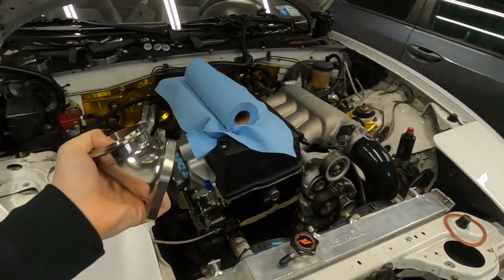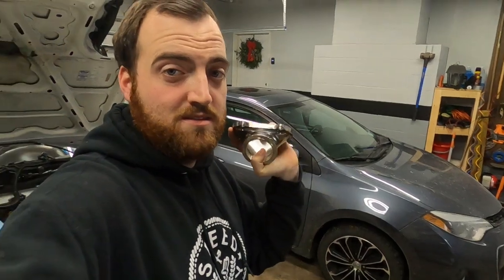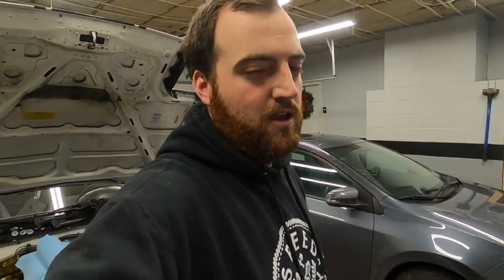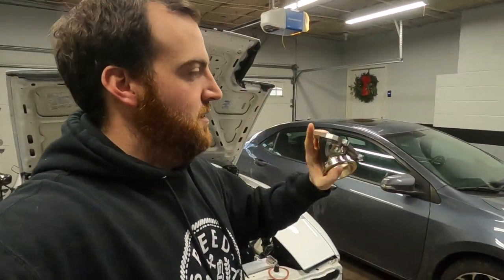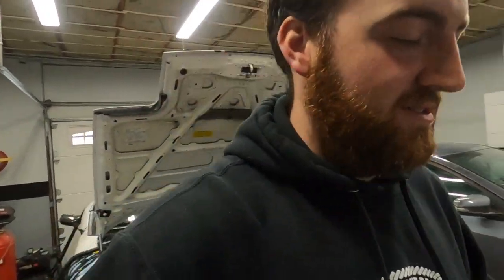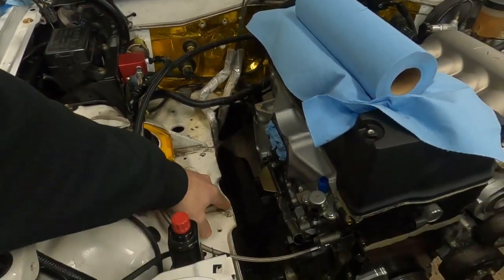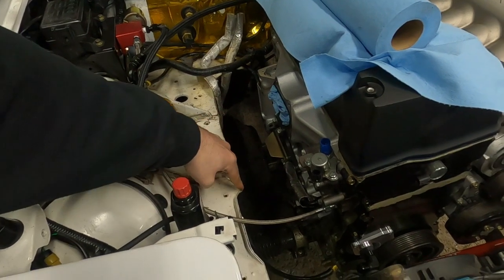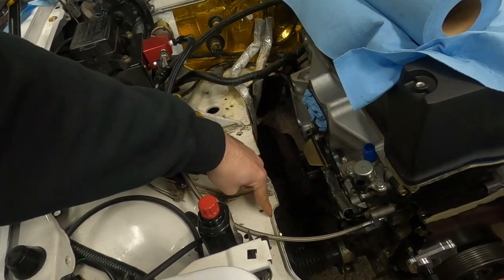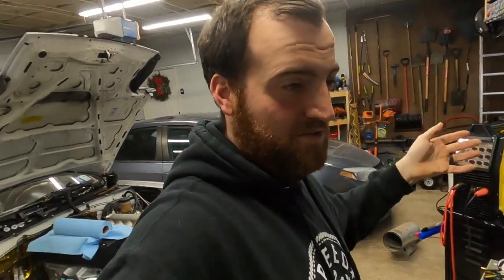I'm gonna bolt this up to the car. The plan is to build the downpipe with this, then once the downpipe is built, I'll take it all off including the hot side of the turbo, ship it to Swain Tech which is right around the corner, have it all Cerakoted, and then bolt it up to the car for one final time. But before we do that — if you saw in the episode where I did the turbo lines, the bracket was really close to the oil drain. So I'm going to take my cut-off wheel and chop this whole ledge right off to eliminate any interference, so I'm not hours from home with a blown oil return line.